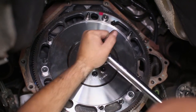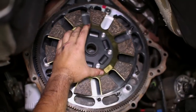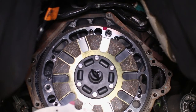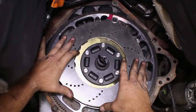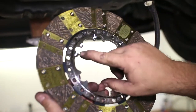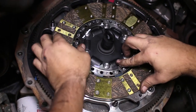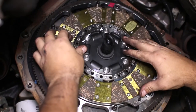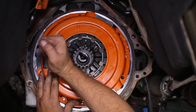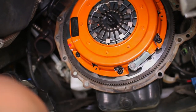Now to install the first of the two clutches — read the label for the correct side and mount the clutch to the flywheel. An alignment tool is provided. The floating flywheel will go next and it is marked on its specific alignment. The second clutch is also labeled and marked on how it should be installed. Make sure to install all of these parts correctly. Attach the pressure plate and thread in the bolts to secure the new clutch system in place.